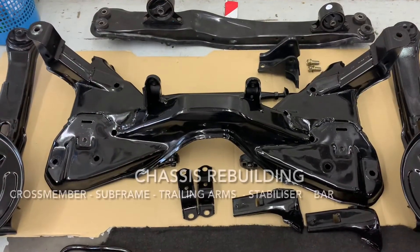Yes, I found the same when we drove the car. We are actually putting back the original suspension and the dampers for the car, and the whole chassis parts including the cross-member and all the mountings and bushes, including the trailing arm bushes, the steering rack, the engine mountings — everything to the chassis will be fully changed here at Forster.